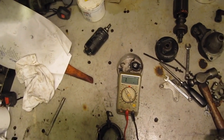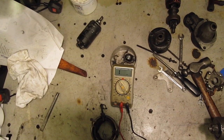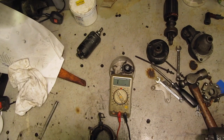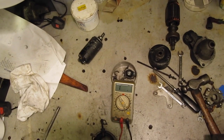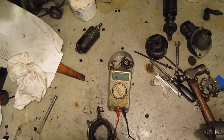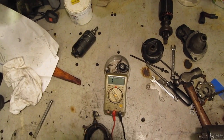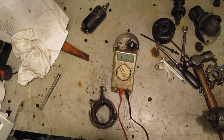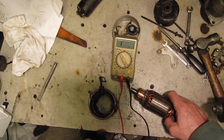Unfortunately I can't test the resistance of the field winding coils because I don't have any data for that, and if there is a short just between two portions of winding in the field coils it's not going to show a significant difference — but it will make a difference to the operation of the starter motor. So there could be an issue there with the field coils, or there could be an issue with a short on the armature.